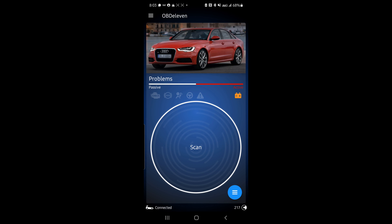This is a hidden menu that comes up on your instrument cluster that will not only display your oil temperature but will also show you your boost gauge as shown through the instrument cluster. This doesn't work for supercharged 3.0Ts — this only works for S6s, S7s, RS6s, RS7s.